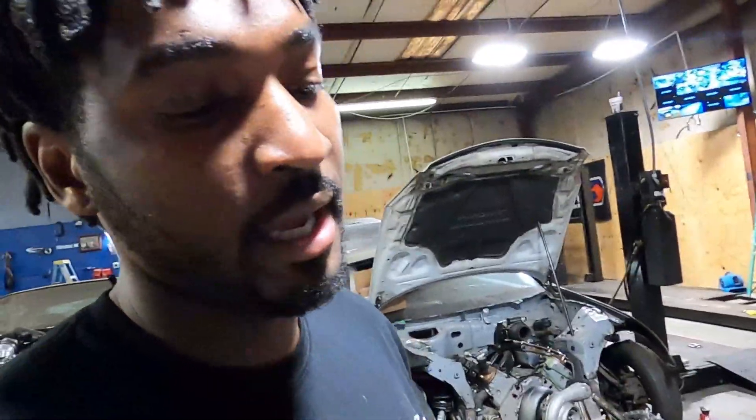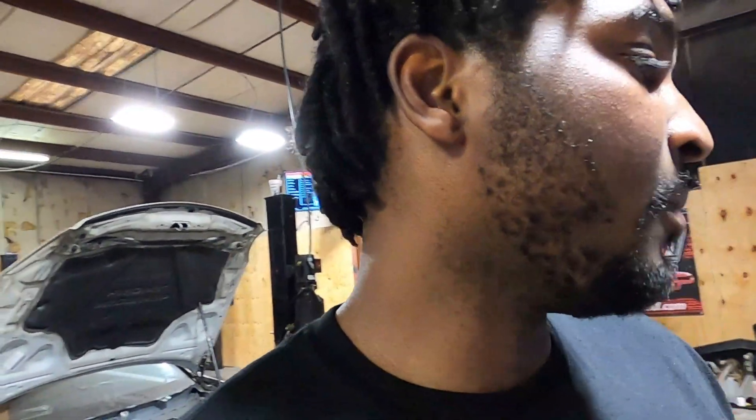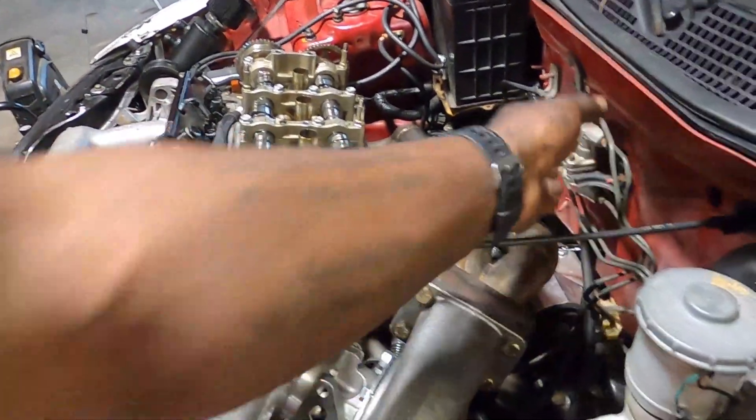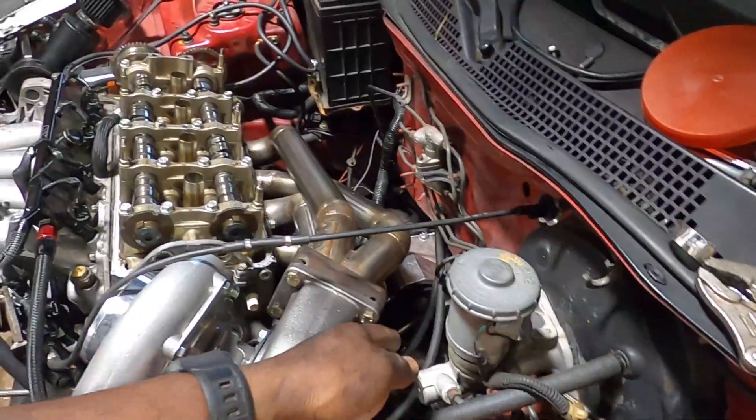Tomorrow I'm going to fabricate and weld all this stuff up. I'm going to redo the fuel system now that I have to move it. I'm also going to weld two 10AN bungs into the valve cover and make catch can lines — I'll put the catch can right here. I'm going to start fabbing the downpipe and dump tubes. Me and Wes came up with how we want to route it — the downpipe will go up and out that way, which is the easiest route since running it down between the wires and cables won't work. That also means I don't have to move the battery to the back, even though I did buy a relocation kit.